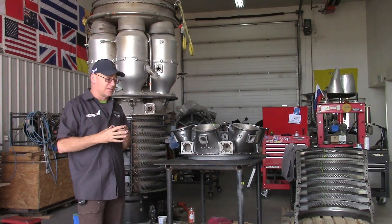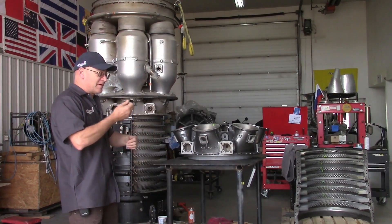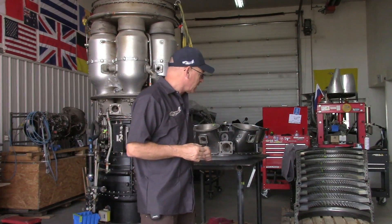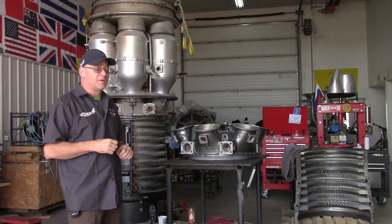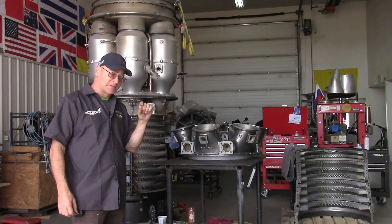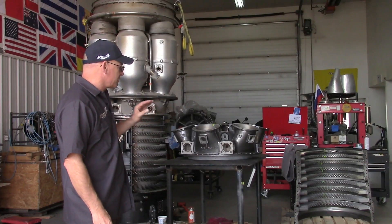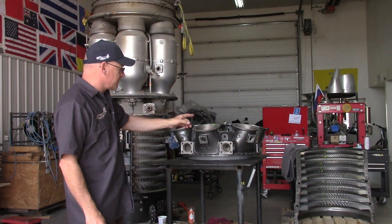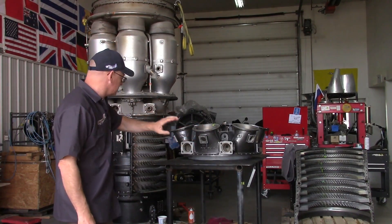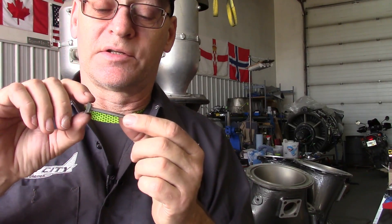The story was there was a little bit of FOD damage to the compressor, so we blended all the blades in place, made it okay. Then we looked at the stators and a lot of them were messed up — nicked, hacked, whatever. If there's a nick near the base of the blade it's unsafe, so we decided to take all the stators and use the same cases from the original engine but take the stators out of the donor engine.